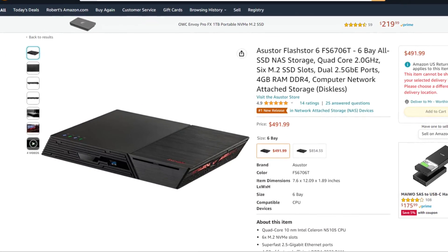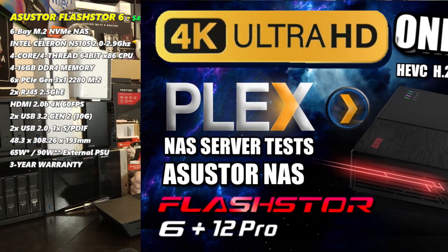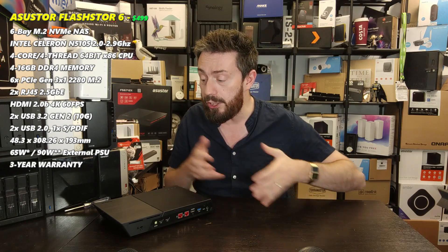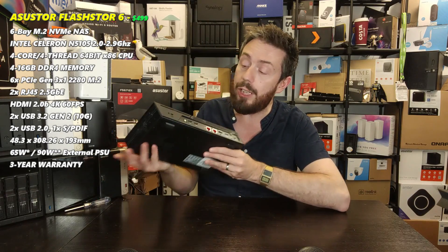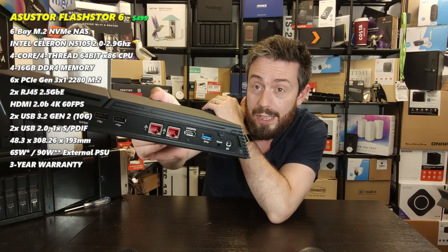This is the first time I've front-loaded one of these best-of videos with an ASUSTOR product: the ASUSTOR Flashstor series. At 499, it is a six-bay NVMe SSD NAS. We've done 4K Plex performance testing on this and 8K Plex performance testing, and it handled both. The ADM software isn't as evolved as QNAP's QTS or Synology's DSM, but it's still very robust — it has Btrfs support, first and third-party apps, broad third-party support, HDMI out at 4K, two 2.5GbE ports, 10GbE USB, and even a specialized S/PDIF audio output.